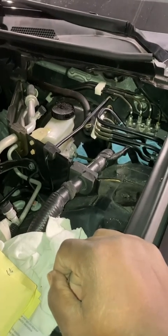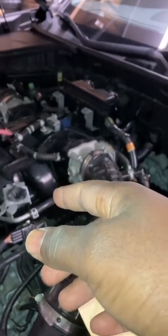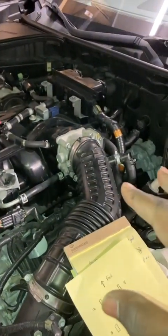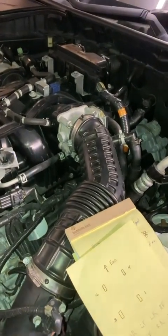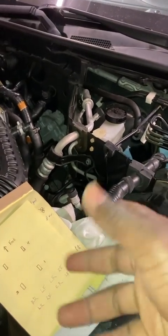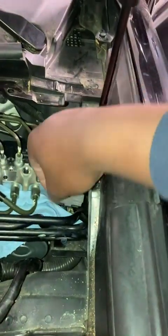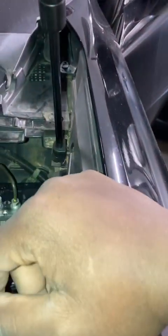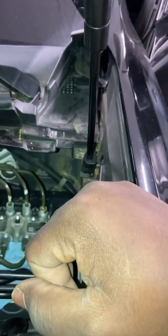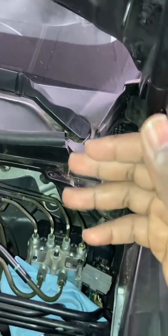So in today's video, you'll be in the vehicle pumping the brakes while I crack the bleeder valves open and bleed them of air. I'll be running back and checking. We need to keep the door open. When you're about to bleed a brake system with ABS, you're supposed to disconnect the ABS module so it doesn't try to do its thing. I disconnected it here — you just disconnect that connector. If you disconnect the battery, you're pretty much killing other systems. So yeah, pull the connector and we're about to go ahead and do our thing.